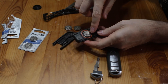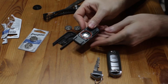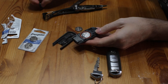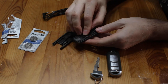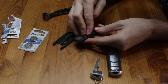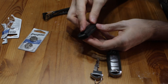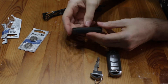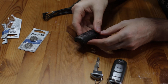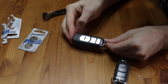This is where the battery is, so just take this out. There is the battery — the CR2025. Take this battery out and then put the new battery in, just face down like this. Then take this and put it back on. That holds the battery in place. Then take the back and snap it in place — just push down and it'll snap right in. Then just put the key back in.